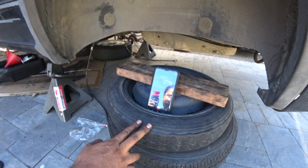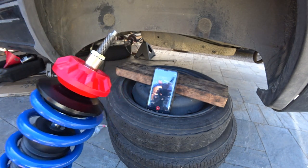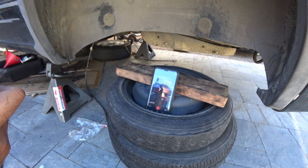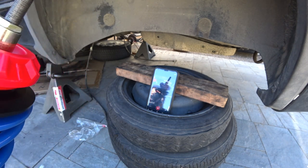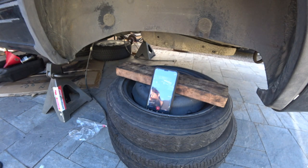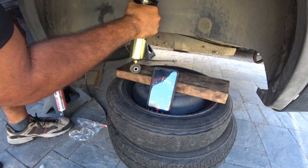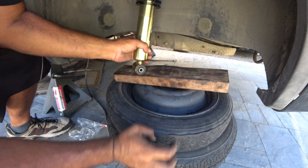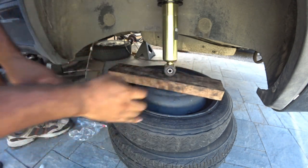You see here I have two tires and a piece of wood — since I don't have the rear beam in, we're going to use this to support the shock in here as well. Right off the bat, make sure you have the bushing, the insert, and the one nut on top already on here — just like that. And then just install the coilover first. And then use your piece of wood just to get that sucker in there.